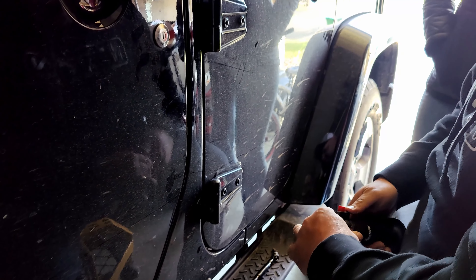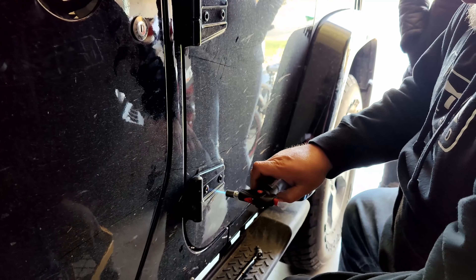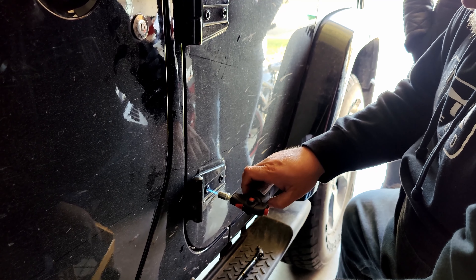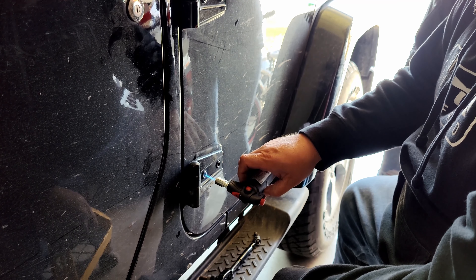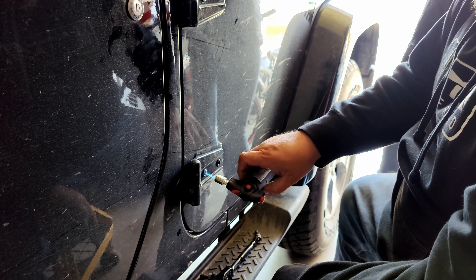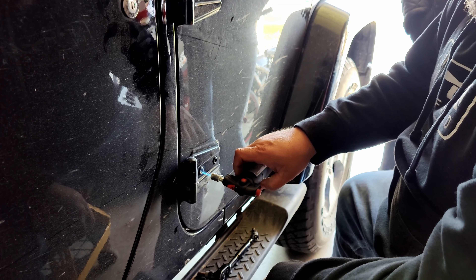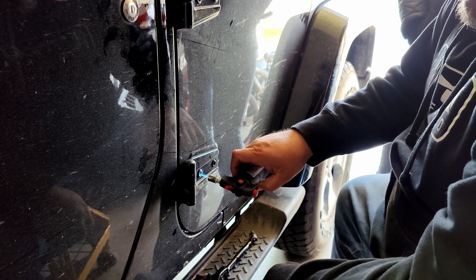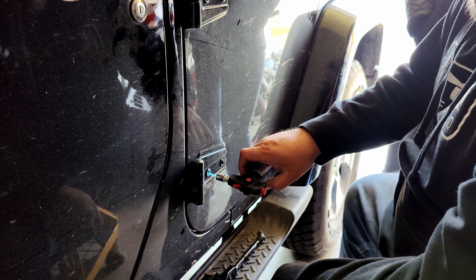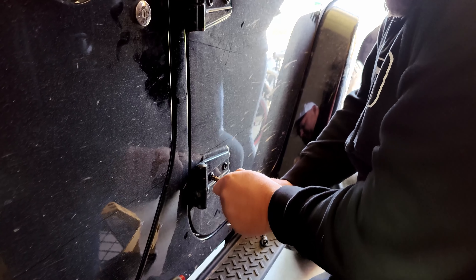Not ready. Not ready. Not ready — that's how you know, don't fight it. Let the torch do the work. Sometimes it helps to turn the torch; I was pointing it a little bit down, so the Loctite on the top might not have melted. Usually like 10 or 12 does it, but I have seen them a little trickier and stickier like this one.